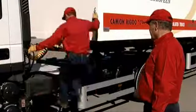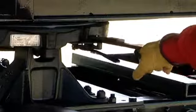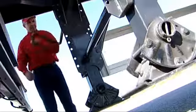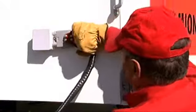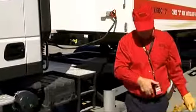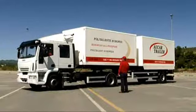The pupil separates the semi-trailer by uncoupling the hoses and the fifth wheel and lowering the support legs. The instructor stands next to the cabin and starts the system by plugging into the electrical outlet. Pressing the forward button on the remote control, the box moves forward until it reaches the cabin.